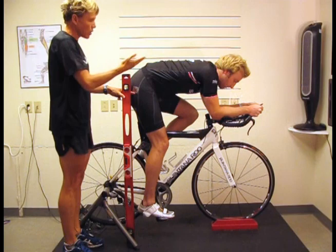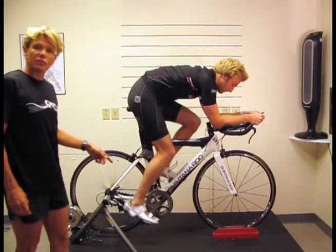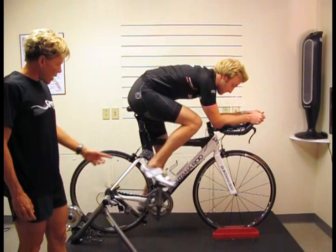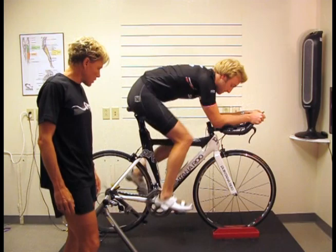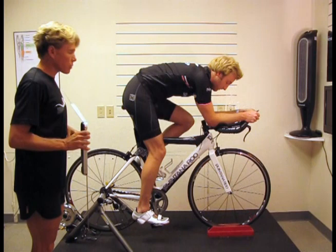Now I'm going to ask Robbie if he can start pedaling, and from his pedaling we can now look at his foot angle. From his foot angle, we're going to see if the seat's at the right level. At the moment, from what we can see, he's very flat. From research and from fast cyclists, it's been proven that 15 degrees is the best angle. But as we can see from Robbie, his angle is slightly flat, indicating that the seat is slightly low. I've asked Robbie to stop cycling now